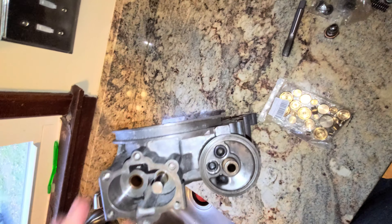So let me show you what it looks like back behind there. With the bypass chamber, as you can see, there's a lot of extra meat and different pieces for holding the springs and the balls. You'll have to take a drill and clean that out to get the M16 tap in there. Once you go down a little bit — there we go — you can see where I'm at for the M16; those first series of taps is where you start. Just run the tap in there after you clean it up with about a 15mm drill bit.